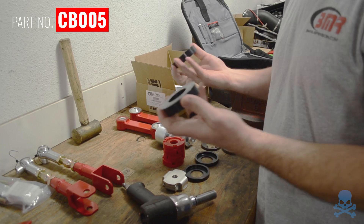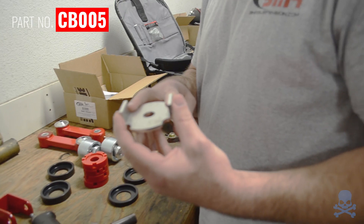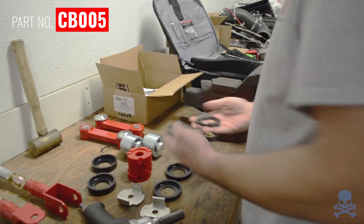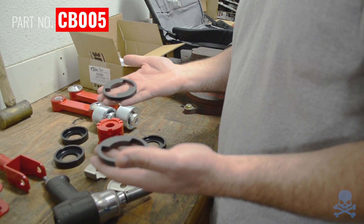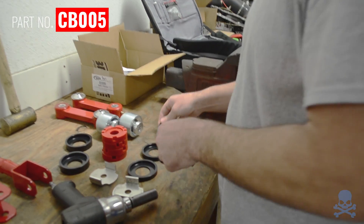You've got the front rings — they're going to be thicker — and then the rear. On the lower bushings, you're going to have these mounts that lock the bottom movement out of the cradle so it doesn't dip down, causing pinion rise. These spacers go on the bottom on the front mounts, so under heavy braking or pretty much any condition, it helps stabilize it by removing the gap that's between the bushing and the washer.